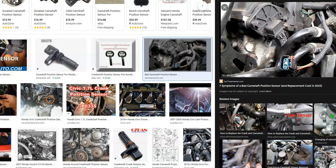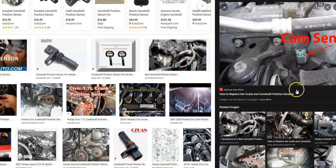Some people just go ahead and order a new sensor, and if that doesn't solve it, they move on to the wiring. Keep in mind that bad wiring can cause the same symptoms as a bad sensor. Also, this whole circuit is usually on a fuse, quite often inside the engine compartment labeled something like SNS or sensor one. Sometimes it can be inside the vehicle under the dashboard. Bad wiring can cause a short and blow a fuse, so you want to locate if there is a fuse. So wiring, a fuse, and a bad sensor are all the things you want to look for.